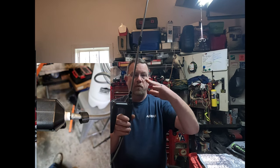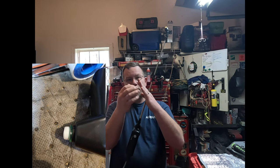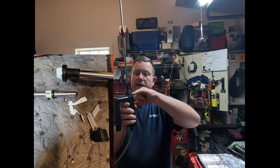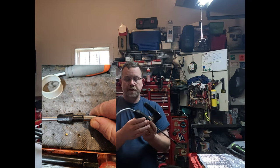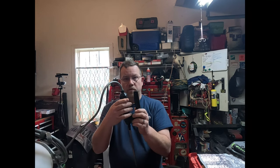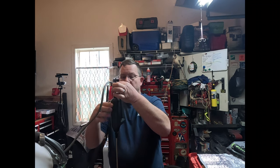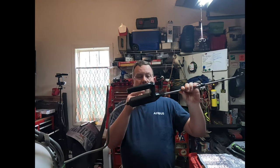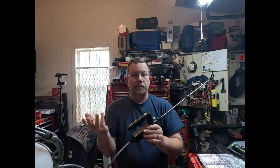You've got the green packing here, but what happens is inside there's packing you smash up, but water will still bleed by and gets through the threads. Once it comes down through the threads it might migrate down in here and then run off in here. Normally I have it clamped up and it's always hanging like this, so over time water got down through here, seeped down through here, and got to the motor.